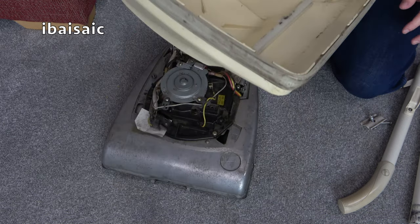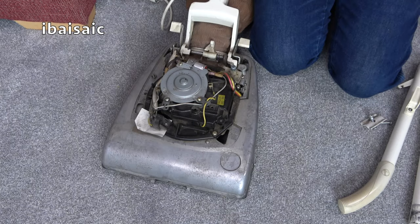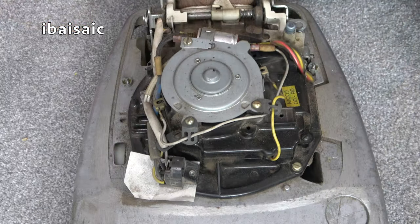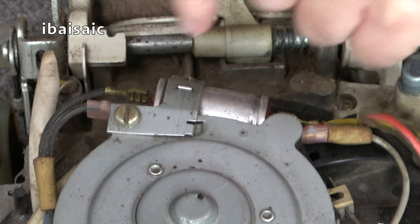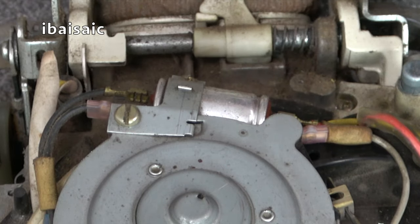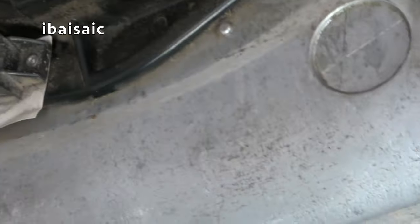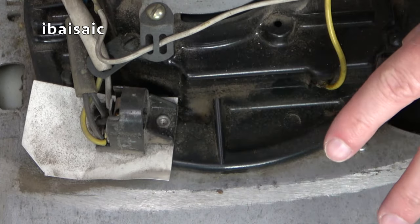There we go. Well, there's the underside of the hood, and here we can see the cleaner itself. Still has the suppressor — yes, that ticking time bomb is just here at the back. A cursory glance — it looks okay. I'm not going to remove it yet. There's no headlight bulb either; I do have some on order from Amazon. Small bayonet fitting — yes, that should fit. It's one of the LED ones I've used successfully in other Hoover Seniors.